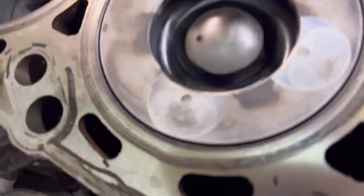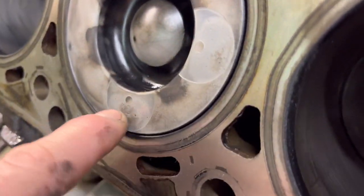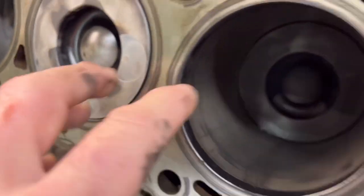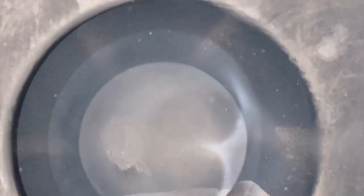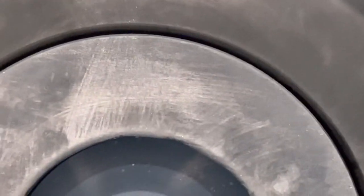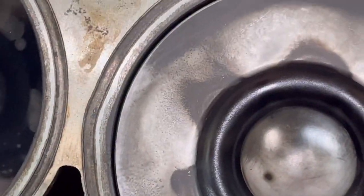I mean, I'm sitting here looking at these witness marks. I've taken so many trucks apart with pretty much witness marks about just like that, and nobody even knew. Like, there'd be witness marks all over the place on ones that I've taken apart. There's nothing on any of these, so, you know. Looks like something there, but I think that's just from us wiping it off. Otherwise, you know, it would be round, right, like that. Pistons look good. Got no witness marks anywhere but the broken spring.